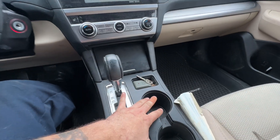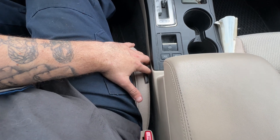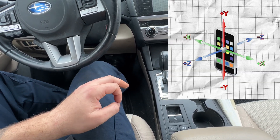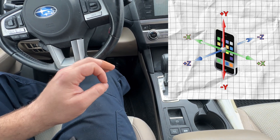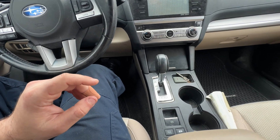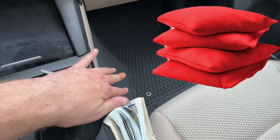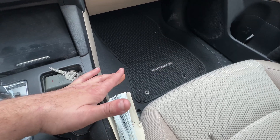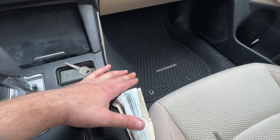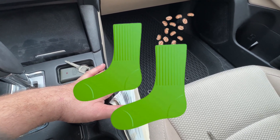Once you've got your Bluetooth device installed and the NVH app running, you need to put the phone somewhere secure — you can't just lay it in the cup holder or on the dash. The NVH app uses your cell phone's accelerometer to pick up vibrations and do the calculations. My favorite trick is a cornhole bean bag on the passenger floorboard — you can get six for about $20, or make your own out of a sock and some pinto beans.